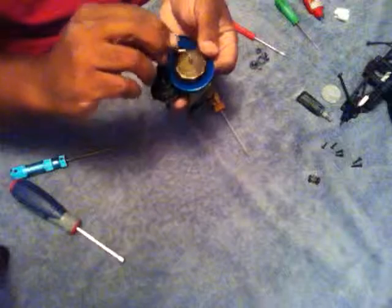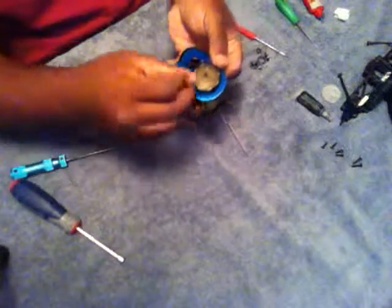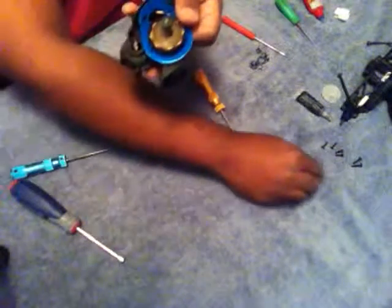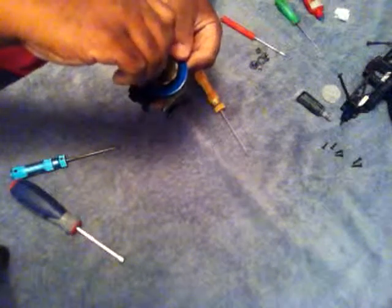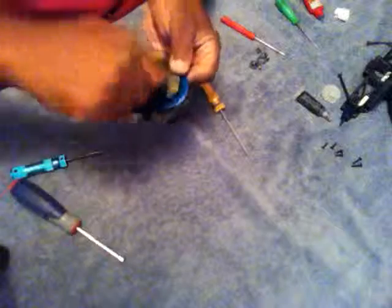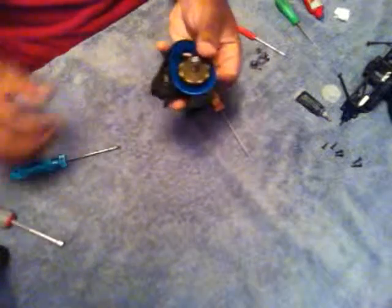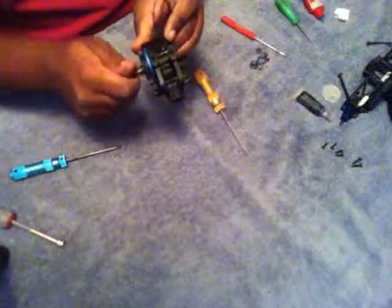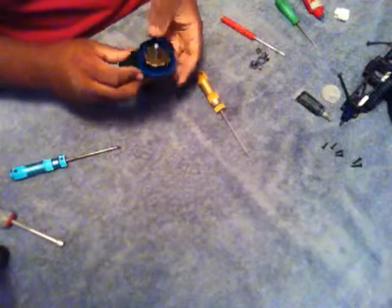our second slipper plate, and the slipper plates are keyed so they will only fit on 1 way, or 2 ways basically. Go ahead and put our spring, the washer, put our lock nut back on. And just go ahead and just tighten that up enough to keep it together. Like I said, those videos will help you set the slipper as well. So, looks like everything's good. Everything's in place and perfect here.